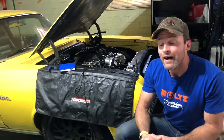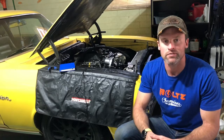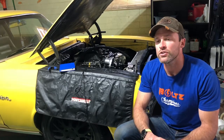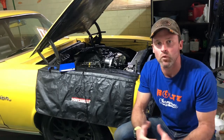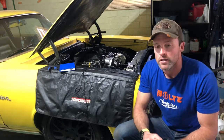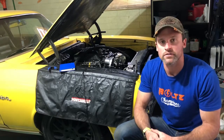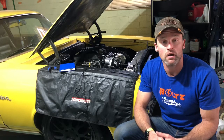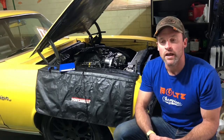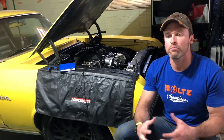You can find a pigtail harness or an adapter harness which would make things loads easier. The problem is those are usually like $25-$30 bucks, and if you're looking at three or four of them, you start spending a ton more money. EFI Connection hooked me up with an IAT sensor and MAP sensor - both connectors were like $7, so I spent about $15 total. I have to do the pinning and wiring myself, but saving money doing three or four sensors adds up. I also don't like having connector-to-connector-to-connector.